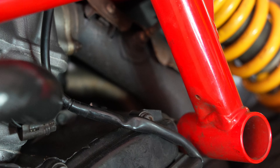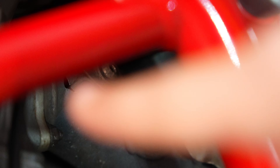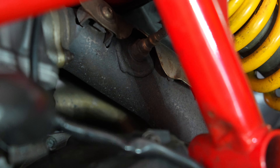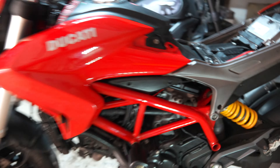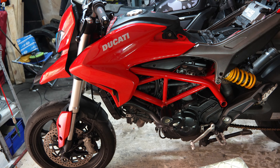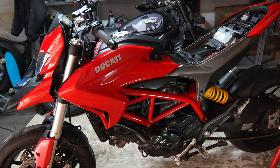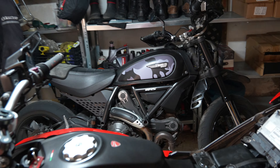As soon as I saw this, I assumed the oxygen sensor was also giving a false reading, getting very lean because fresh air was getting into the exhaust. The O2 sensor was thinking the mixture was very lean and compensating with more and more fuel, so the mixture itself got rich. With a combination of leaking exhaust and the O2 sensor malfunctioning, we obviously got a lot of misfiring — which unfortunately kind of ruined the hype, since it was the first time I was going to the track with the Hypermotard. Usually I go with the Ducati Scrambler.